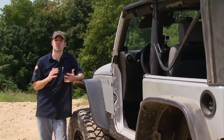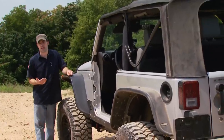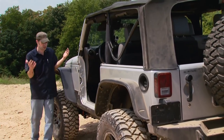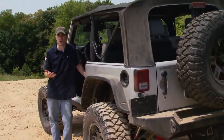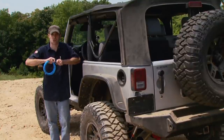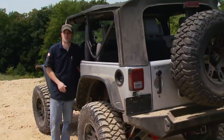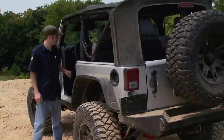Welcome back. After a full day out on the trail testing our 07 Jeep Wrangler, it just about puts this project to bed. We did just about everything you can do to a Jeep: the 5.7 Hemi swap, heavy-duty front axle, gears, lockers, axle shafts, lift kit, tires, wheels, bumper, winch, rocker protection, and tire carrier — and everything performed like it was supposed to. We come prepared: we bring tools and extra fluids out on the trail, and we also packed the extra air locker line that came in the installation kit along with a couple of repair unions so you can make a trail fix. If you happen to crush one of these lines on the trail or burn it on the exhaust, your air lockers aren't going to work — you'll be stuck with open diffs. So take one of these kits along, be prepared, and keep rolling on the trail.